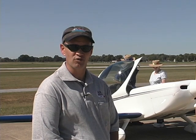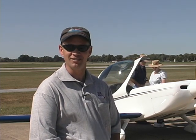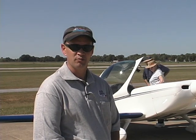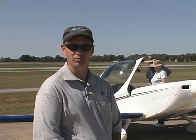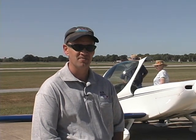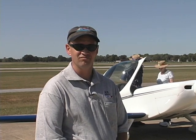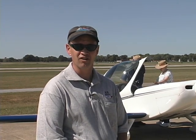We had to push our engine forward, my engine. I say we, because Rich Shirley helps me quite a bit. We pushed the engine forward 3 inches, put the CG right on with he and I up in the airplane. It's 440 pounds, pilot and passenger. I only had fuel in the header tank, which is 12 gallons. Flies wonderfully, not a problem at all.